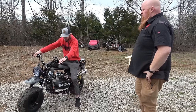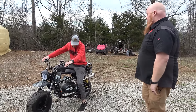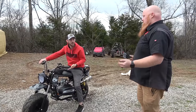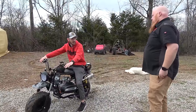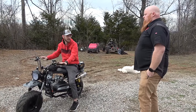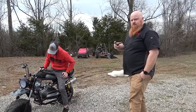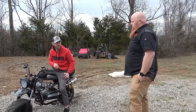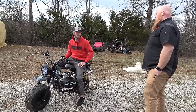Bro. That lift kit works great. I don't feel any kind of flat, which I wouldn't expect us to, but still, that exhaust sounds real good. That felt fun for a stock engine. We put the Tillotson carb on it, which is like a stock carb, just with an adjustable needle and stuff, and then the exhaust and the 62 sprocket. All that put together made it feel pretty dang fun.